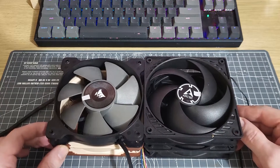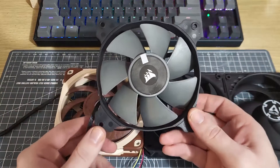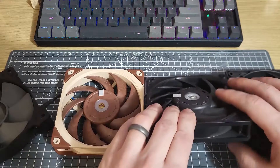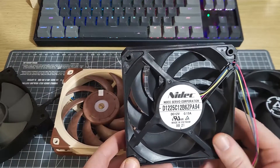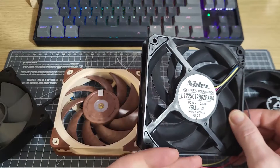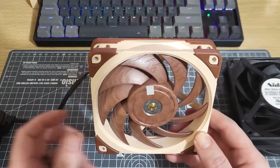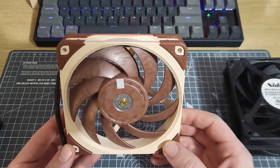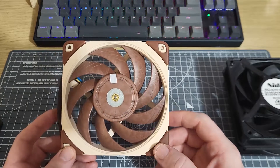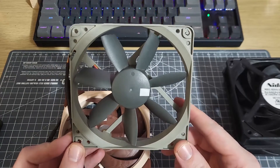You might recognise some of the fans I've got in front of me here. Budget King, the Arctic P12. I've got the early version of the Corsair SP120, which is just a case fan from an old Corsair gaming case. I've got the fabled Gentle Typhoon — this is a slightly newer version, but it's the same fan. This one runs a little faster at 2150 RPM and unlike the older fans, it has a 4-wire PWM connection. And of course, the Noctua A12X25, which is a fantastic high-quality 120mm fan. These fans are commonly considered high-pressure fans, and a fan like this — the Noctua S12 — would be considered an airflow fan.